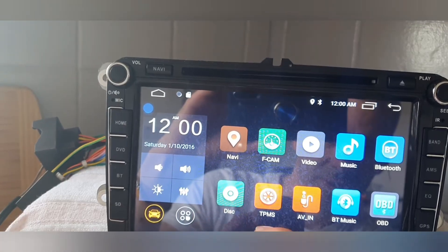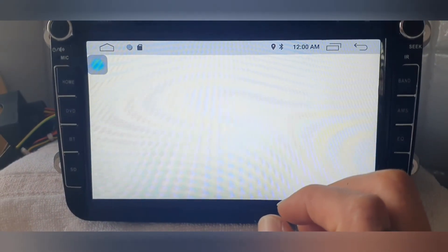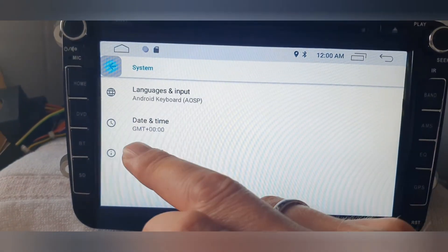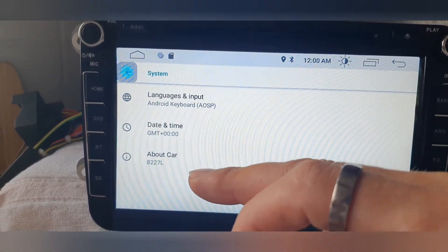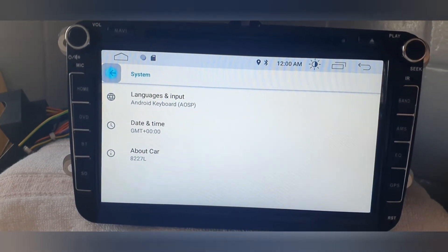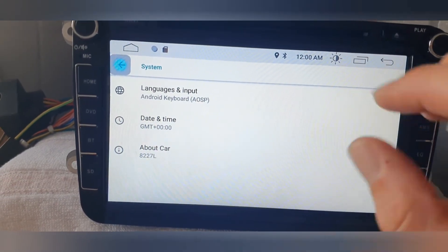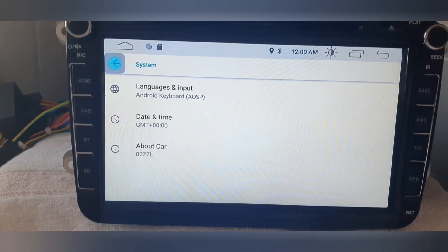If we go into Settings, on my other cheaper head unit when you scroll down to System there is a factory reset option — but that option only appears on cheaper head units, not on these more expensive ones. I tried contacting the seller with no response, and when I have spoken to them they just say it can't be done. It can be done: hit the reset button while it's loading up, all five fingers tapping on the screen, and it will send it into factory reset mode and wipe everything.